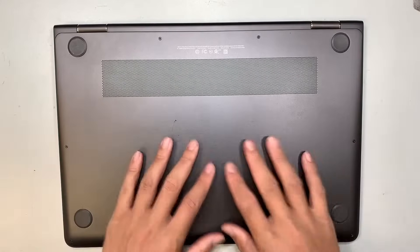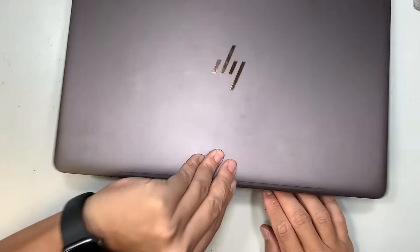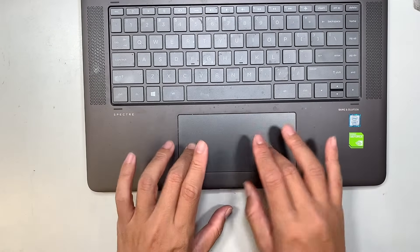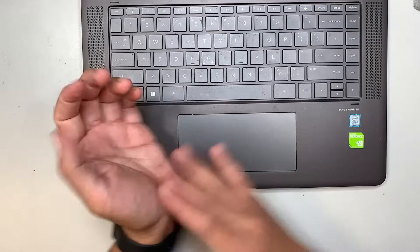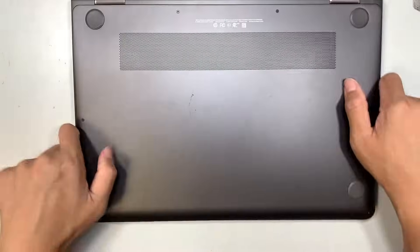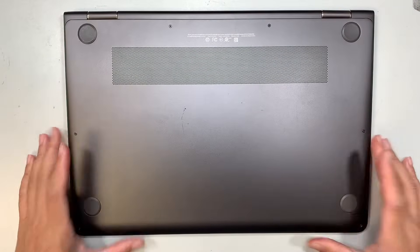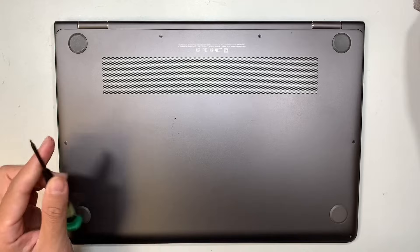What happened is you can feel the trackpad or the back of the computer has a lump on it, so when I try to click on the trackpad it is not clickable — it's super solid, the clicking is all gone. The palm rest where you rest your palm is actually a little lumpy and swollen in that area, which is where the battery is located. The second sign is if the computer is not holding a charge or the battery dies off very quickly — those are the early signs for replacement.